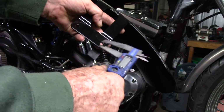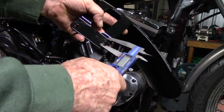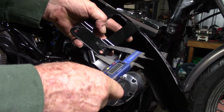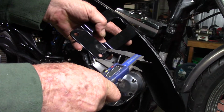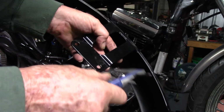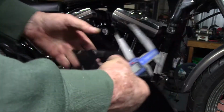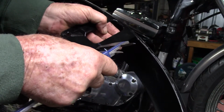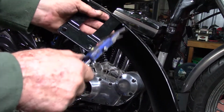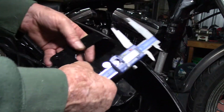So, if the vernier had the battery and it was working, you'd get the centre, add on 16 mil or 625 thou, go scratch. I'm going to do it because I am going to drill this guard anyway. Scratch, scratch, scratch. Center punch, center punch, center punch, center punch. Drill, drill. Go a little bit bigger.